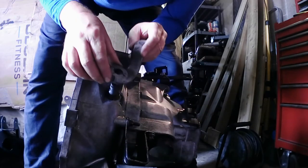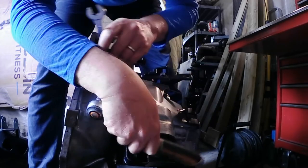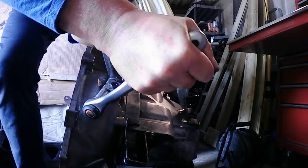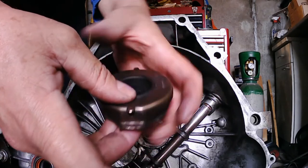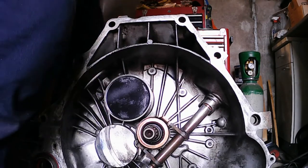The splines in there line up on the splines on the shaft to get it positioned — there's only one way it goes on — and we'll go clicky click. Getting the little release bearing in place with high temperature grease in the areas that need it. Put the clutch on the engine, put the engine back on the subframe connected to the gearbox. Once back together, we'll see if the clutch feels any lighter.